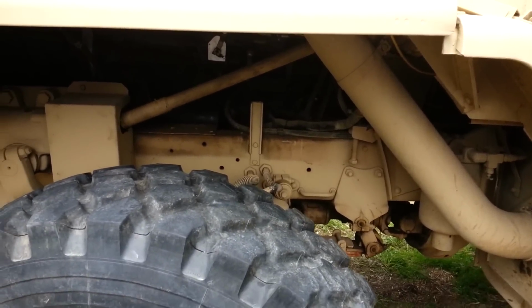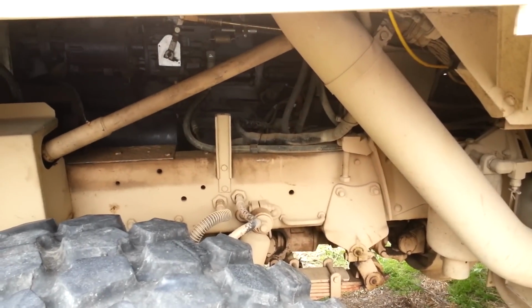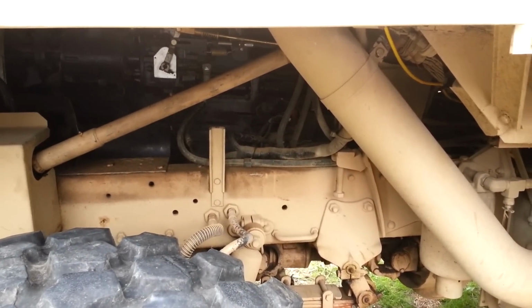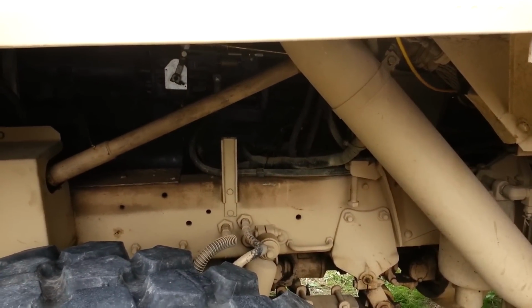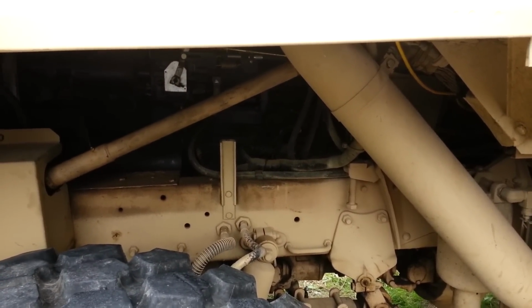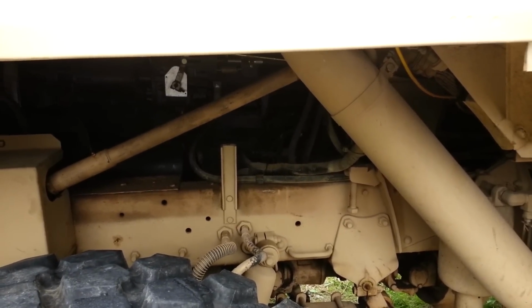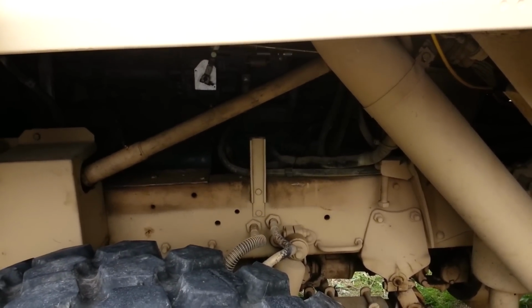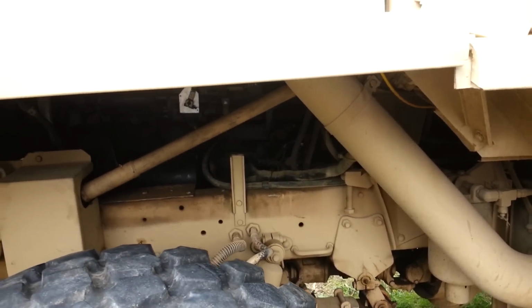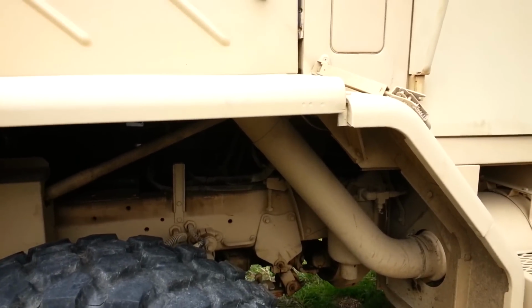That could be cam bearings, I guess. Could be a cam bearing. It doesn't look like rods and mains. It really doesn't. So I'm not sure where else it could get aluminum that it could roll out, hammer out. So I don't know. It's a bummer.